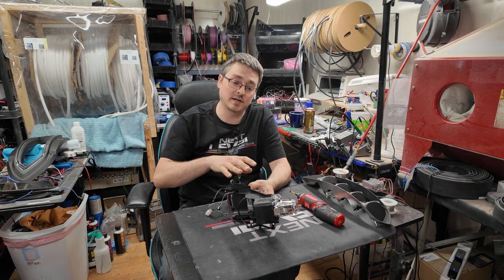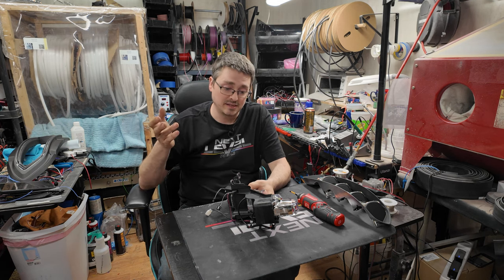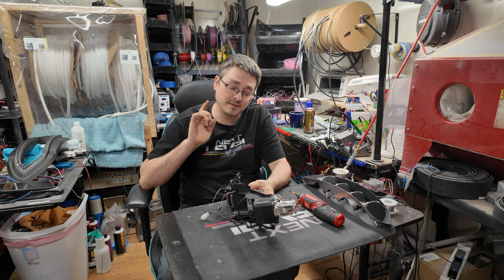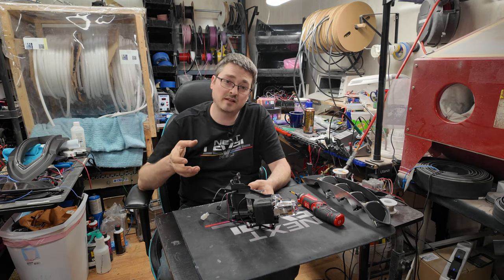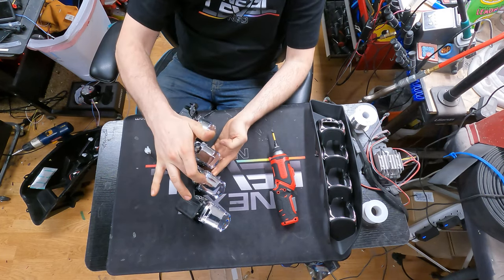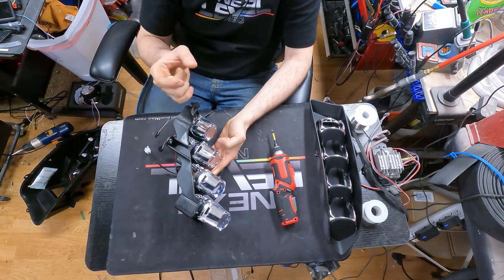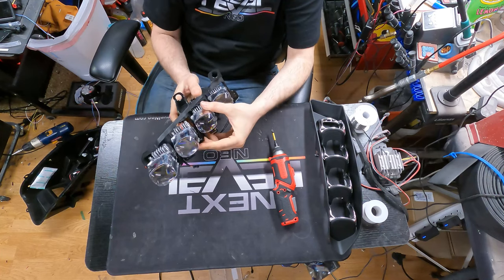I have a set of Alpharex on my truck, and I could never figure out a way to etch them. So I'm not going to bother on this set, but we are going to add demon eyes. Now, adding demon eyes is also a little bit of a challenge with the way these projectors are laid out, because there is no real hole on the top to point an LED in. You can't easily put an LED inside because they are quite small projectors.